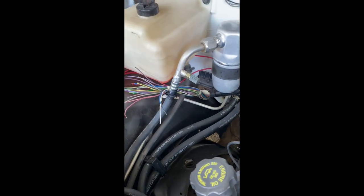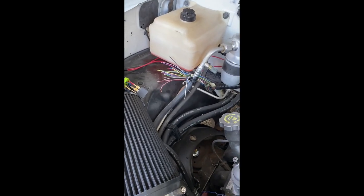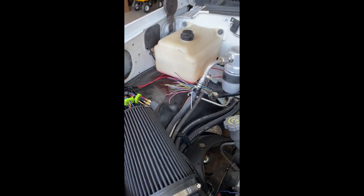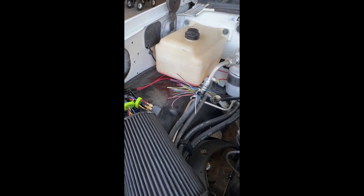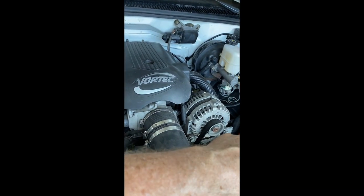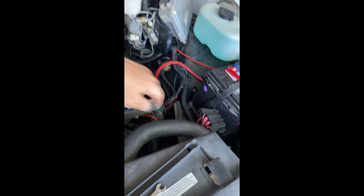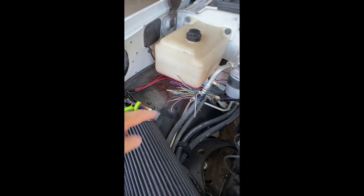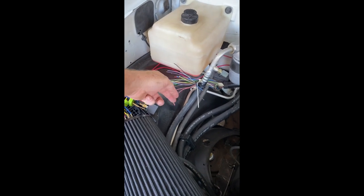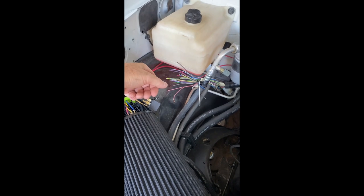This is a cluster of wires that come out of the firewall from the old PCM on the OBS. I've cut them back, trimmed them back and thinned it out, but I have not eliminated them yet — and here's a good reason why. I need key-on power, and rather than trying to run a wire from the relays all the way over to the other side where the fuse panel is to get to the pink key-on power wires, I wanted to find an existing power wire in the OBS harness. This one was pink, and I thought — why not, let's give it a try.